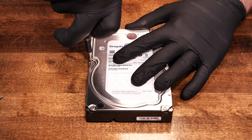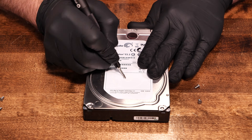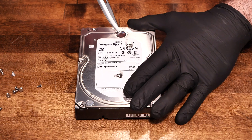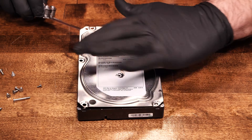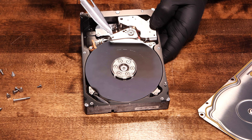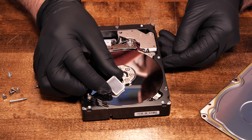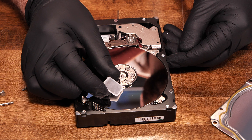For a bit of added fun, let's open up the failed Seagate drive and see if we can spot the issue. These Constellation 3TB drives are notorious for head crashes and are well-known for being unreliable after their three-year warranty period. The date of manufacture of this failed drive was 12-20-2015, so for it to last until early 2022 — a little over six years — is a surprise. After removing all the screws and opening up the drive, we can see a very faint circular scratch in the middle of the top platter, which leads me to believe the drive was beginning to head crash. That's backed up by the air filter in the drive — see how the filter is dark-colored on one side? That's the filter doing its job, picking up all the little bits of scraped-off magnetic material from the glass platters. In a normal drive, this absorbent filter should be white on both sides.